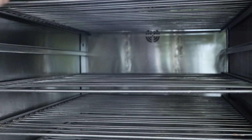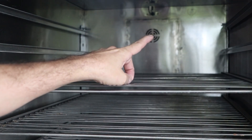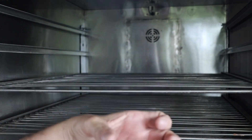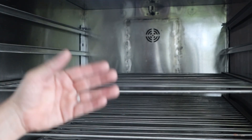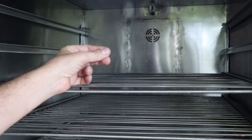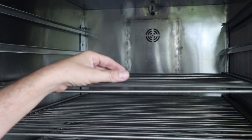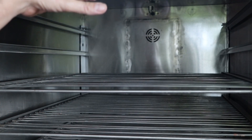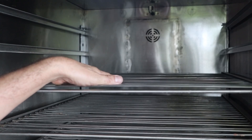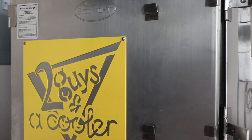Notice that vent in the very back of the smoker. There is ductwork that comes from the very bottom all the way to the very top, and there's a fan at the bottom that's designed to draw air in and blow it out the top, creating a convection-style smoker which has a ton of benefits. If it works, this should heat your smoker up a lot faster, get rid of any hot zones, and cook your food a lot faster with that hot air constantly being recirculated.